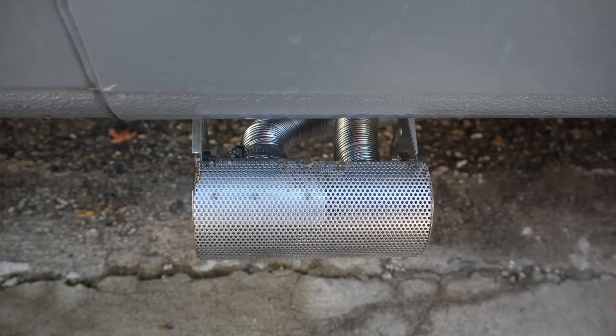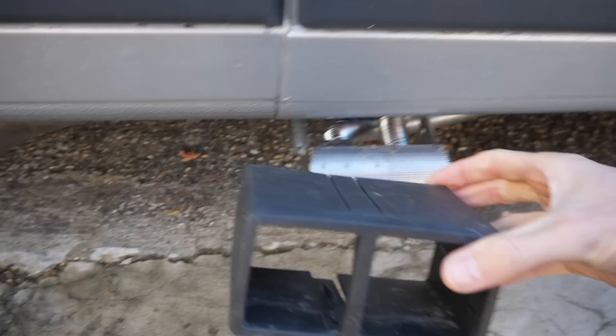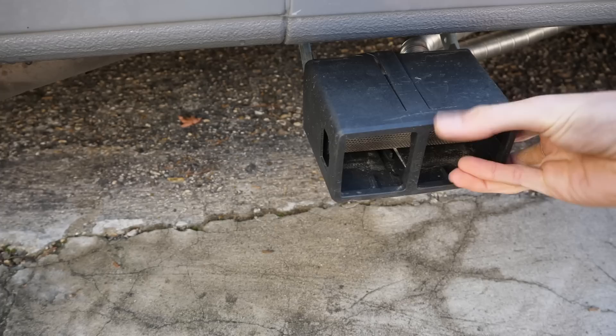So originally I did get the pipes on the right way around, but the exhaust head itself — on one side it has this hole and that's where the exhaust gases come out. That side, if it's going to be on the rear as I have done, needs to be pointing sort of towards the rear wheel. Then on the cover itself there's only one side with a hole, so you can see where this goes — it slides on like that and clips into place.